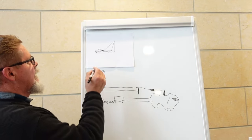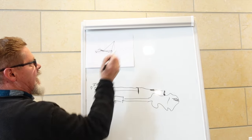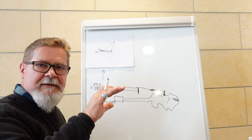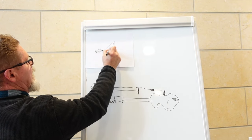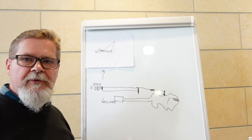But again, if your poles are on the headache rack and you don't take this winch line and go out and improve your angle of pull and lessen the tension, and you pull from here, it goes up to here, this block is going to want to come right through the back window.